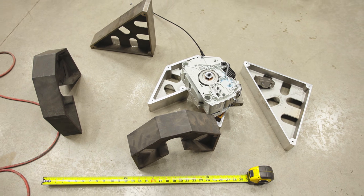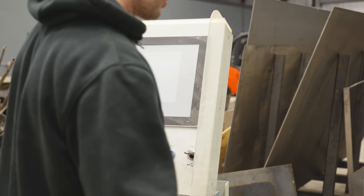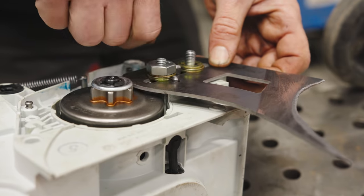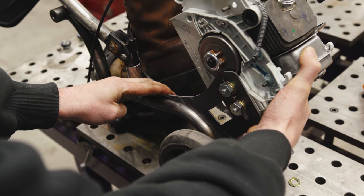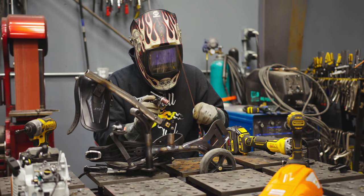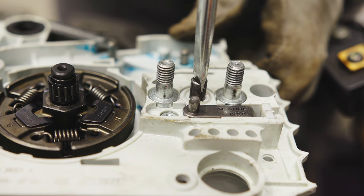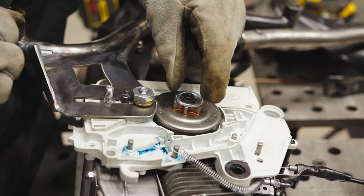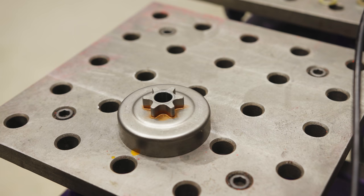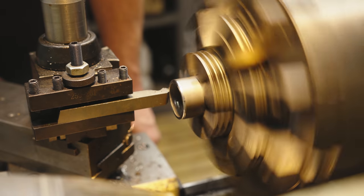With the remote throttle figured out, it's time to sort out where the motor gets mounted. I mocked up on the floor where I'd like the motor to sit, taking into consideration the rotation of the engine, how to keep it out of the way from my foot, how to keep the center of gravity low, whether I can reach the pull start and kill switch, the rotation of the engine so I don't go backwards, what part of the frame is strong enough to hold the motor, and how to position it to drive the wheel. The chainsaw has a built-in chain adjuster, and I'm going to utilize that to put tension on the drive shaft that's going to make contact with the wheel. This is the most simple, elegant solution — hardly any moving parts, nothing to go wrong, just a contact wheel touching the tire.